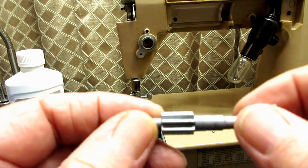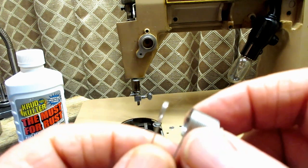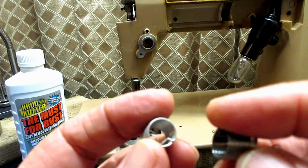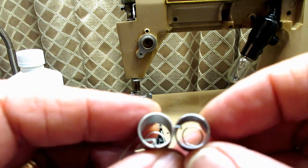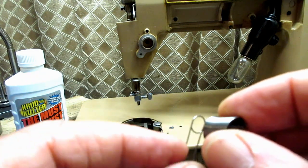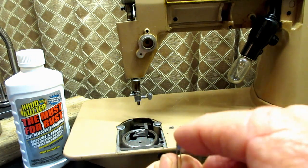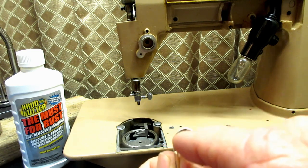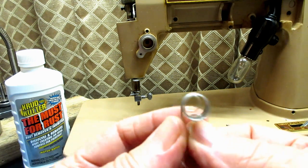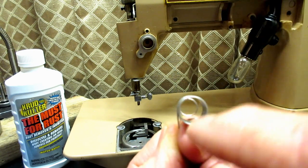You can buy these tension units new, and I've used them with pretty good success, but I want to say they are a tiny bit different. They have a little bit bigger diameter. With the factory original one, with the loop down, the tail is going to be up here towards the top — anywhere from 11 to 1 o'clock, usually right at 12 o'clock. On what I call aftermarket or non-OEM ones, with that loop down the tail is usually down at about 5 o'clock.